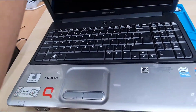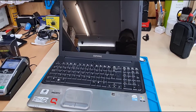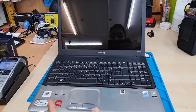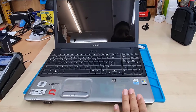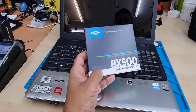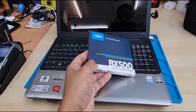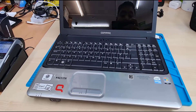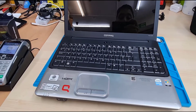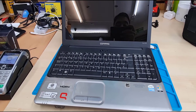Today in 2021, I am planning to upgrade it, but there are not enough opportunities to upgrade except physically. We can change the hard drive to an SSD — definitely SATA, because there is no M.2 slot — and also upgrading the RAM and installing new software, either Windows 10 or Windows 7, whatever you like.